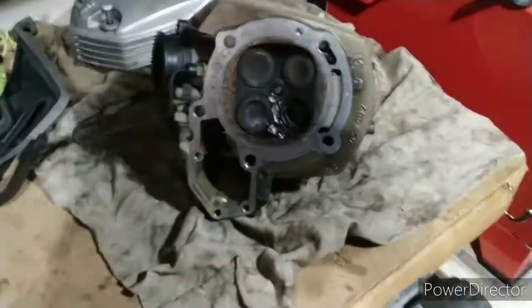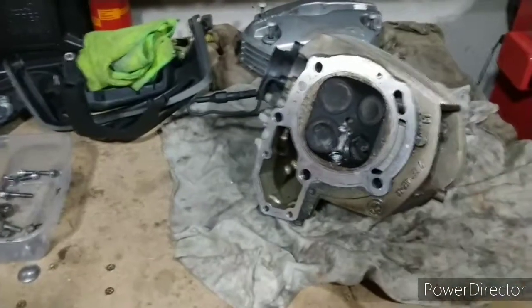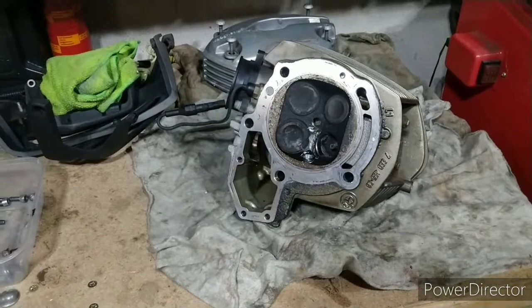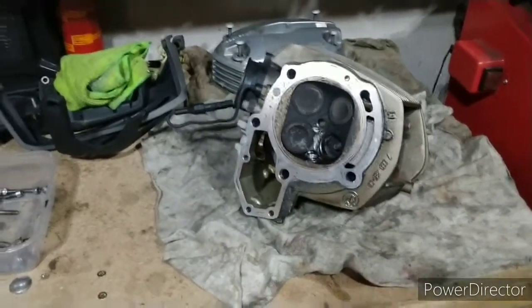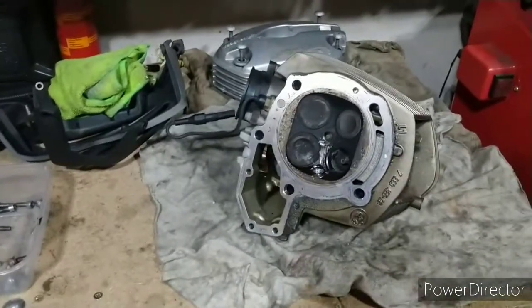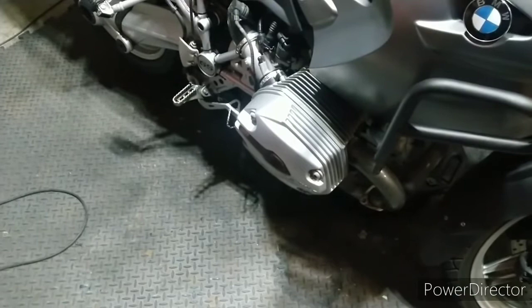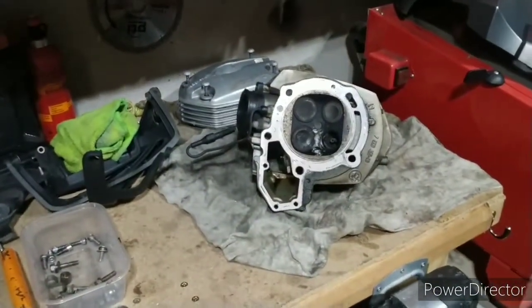Moving on to the head - I originally thought I'd just replace all the valves, until I found out the price: one exhaust valve, dealer price, £117 including VAT. I've managed to buy a second-hand one on Motoworks, which is a pretty good online parts supplier I've used before. These heads are going to be completely rebuilt - I'll strip them down completely, clean up the valves, reseat them, basically a total rebuild. I'll complete one head first, get it back on, and then do the other, which I won't be touching the piston on. That's my plan - complete head rebuild on both.